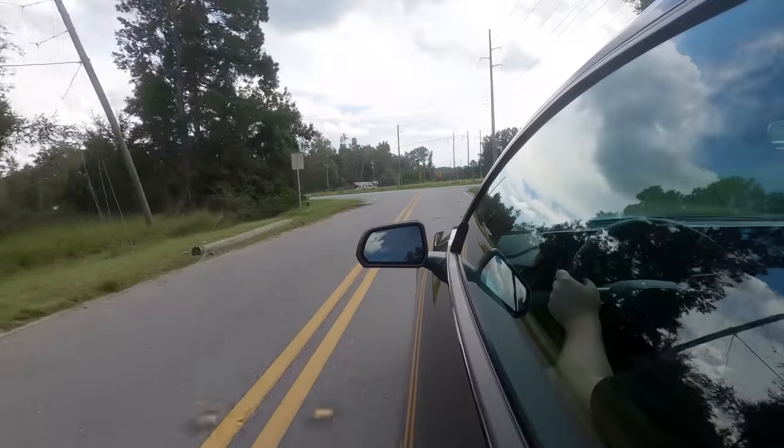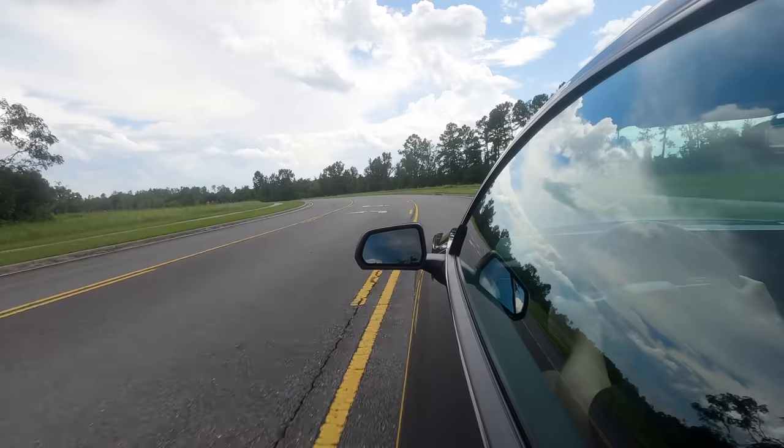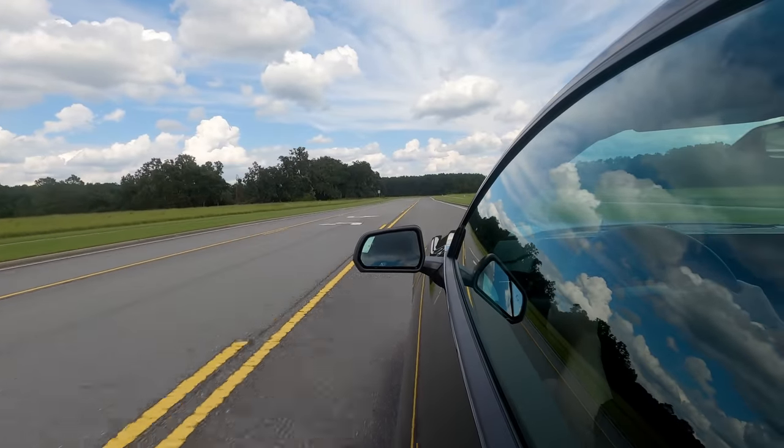As you can see, we just had a hurricane go through — a lot of cleanup going on around Valdosta. Thankfully everyone's safe. You sure the tires don't still have some mold release on them? I'm not going to push it too much, but it does feel nice and flat. Snappy shifts too. Definitely feels more of a race car today. When you put it into those turns it is just nice and flat. The higher spring rates and everything's working well together, but you're starting to feel a little more body roll — it's making me want our front sway bar on here.